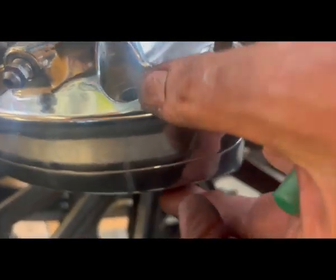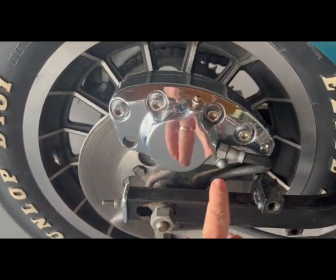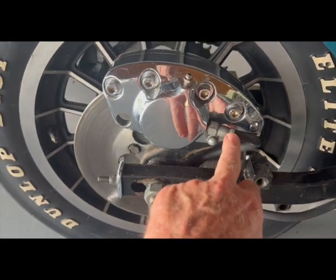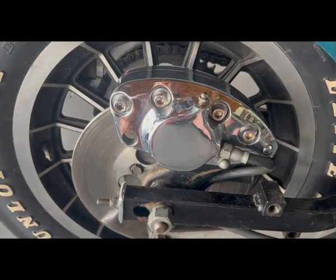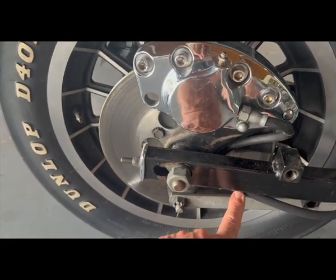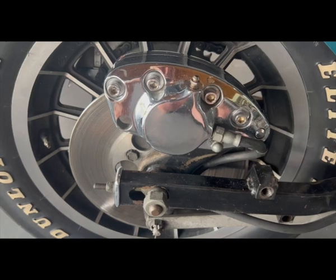At this point you're ready to go. We got this one all back together and on here. The other thing I always want to point out is this here screws directly into that. Unless you unscrew it from back of the master cylinder — or back at the light switch valve, it's back there — you're going to have a hard time because it screws directly into that. I knew that taking it apart and I forgot and put it all back together. I should have redid that with a swivel connection or something which would make it a lot easier, or put another block down here somewhere. It has a little bracket clamp that holds that on there as well. But there she is all back on there and we're just going ahead and bleeding that. Looks like we have new brakes on the back.